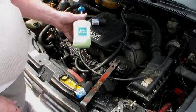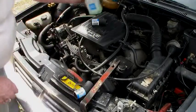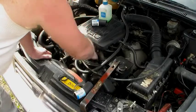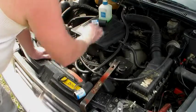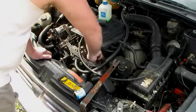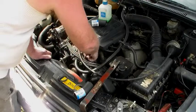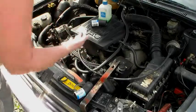Give me a little dish soap here to help slide these on. This is not the ideal way to do this, but you want to check these hoses back here. It really hasn't been that long since I put this water pump on — I probably should have replaced these two hoses, but at the time they seemed to be in pretty good shape. We're paying the price now. What I'm doing is taking that dish soap and rubbing it around on there so it'll slide on better.